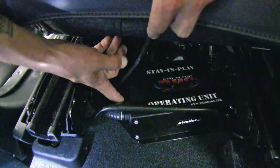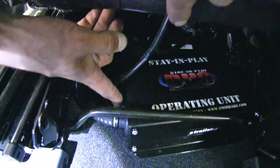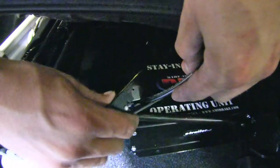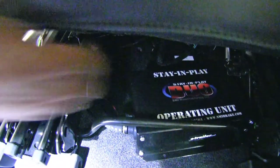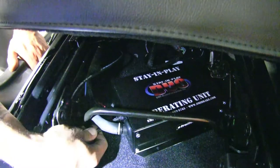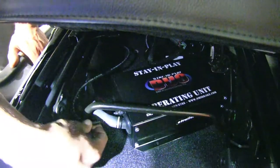The air fitting going into our control unit is going to be right next to our vacuum line right here. So I'm going to give myself a little bit of extra room. I'll go ahead and cut my airline tube, and then we can plug it in. Give it a nice little tug to make sure it's not going to come back out.